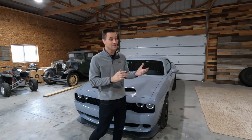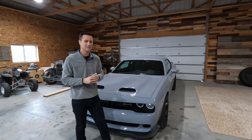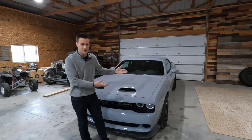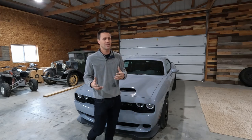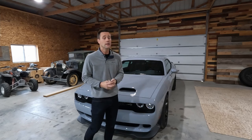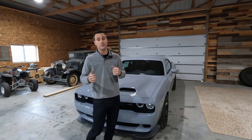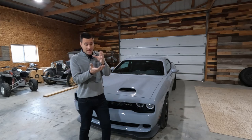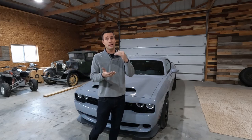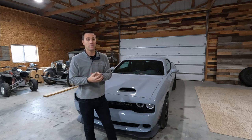I'd love to see the thing on the dyno once it gets some miles — this is brand new, it just got driven to the shop. But today we are going to be doing one of the things I think is a very important first mod. It doesn't add horsepower, but it keeps the engine clean. We're going to be installing an oil catch can, or oil separator, that goes in line with the PCV valve system — a can that collects water vapor, oil vapor, and anything that would normally be pulled into the intake or supercharger.